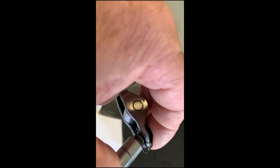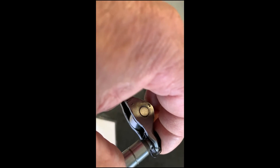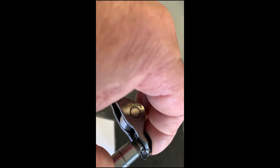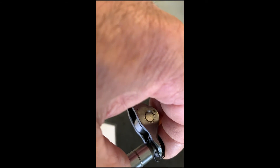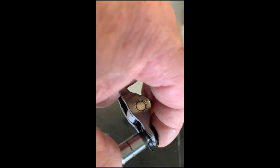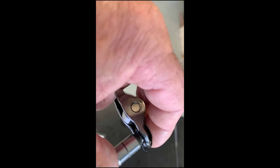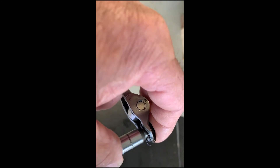All the necessary clearances on the valve should be done prior to fitting the clip. The clip should go on last and it should be squeezed in your fingers as tight as possible, then pushed onto the rocker to allow the pivot at the bottom to have the clearance it needs. With the bespoke ones it's not as critical, but with the machined ones it's very important.